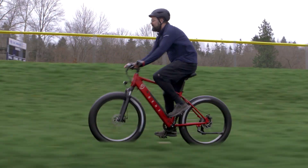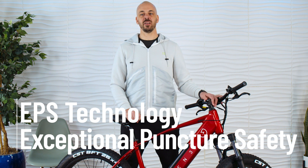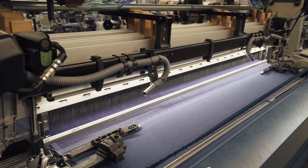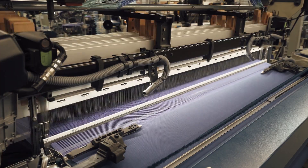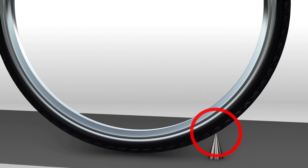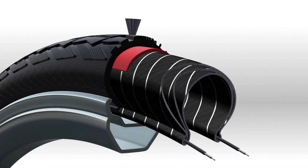To minimize the risk of tire punctures that can put a pause on your adventure, these tires feature CST's EPS technology. The acronym means Exceptional Puncture Safety, which this tire delivers — simply put, fewer flats and fewer punctures when out riding. Aside from the normal materials that go into making a high quality bike tire, EPS also offers an added layer of proprietary rubberized polyfiber material between the tread and the casing. The tight weave of this lightweight layer helps prevent foreign objects from penetrating the casing and damaging the tube.